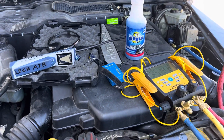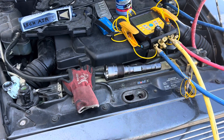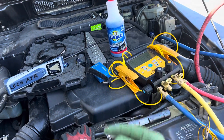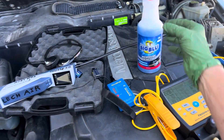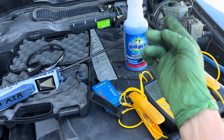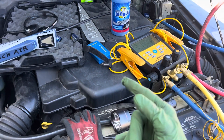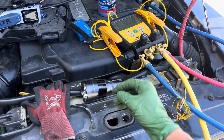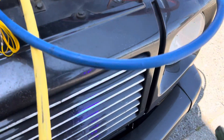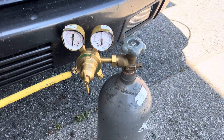Now they have new dyes that are extremely concentrated - just five milliliters is good enough for up to 10 or 14 ounces of refrigerant oil. So on a small compact car that only takes two or three ounces of oil, you only need one or two milliliters. I spend around $200 on a container of concentrated tracer line refrigerant oil dye and I could do several hundred cars. You have no excuse saying you don't want to spend $200 - think about how many cars you can do with it. If you're not investing correctly in quality products, test equipment, and education, you don't belong in this trade.